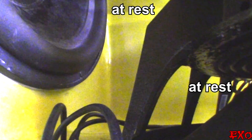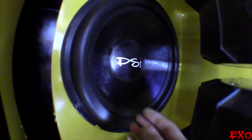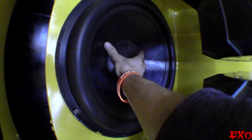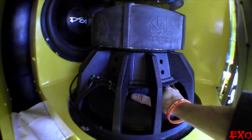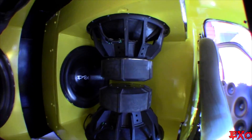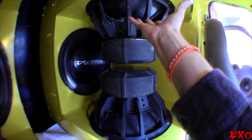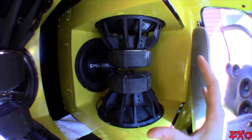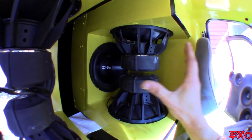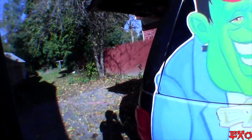Okay YouTube, so as you can see, this subwoofer was pushing in — it was pushing into the box — and this subwoofer right here was also pushing into the box. So think of these like bellows: it was pushing air in, as well as this one pushing air in. So all three of these woofers — while this one is pushing in this way, this one is pushing that way, and this one is pushing that way — all going into the enclosure. So what that is really demonstrating is that all the subwoofers are working together.